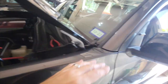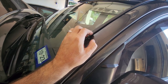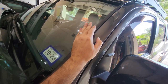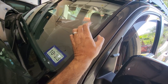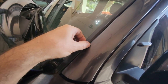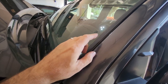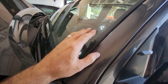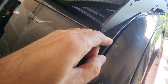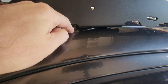All I have left to do is tuck the wire along here. I might use a piece of plastic — something that won't damage the trim — and gently tap it in with a hammer. I certainly don't want to get into the windshield over here. I did check the depth of this groove and it's much wider and deeper than the wiring, so there's plenty of room. The only hiccup will be up where it narrows a bit, and then the rest will just sit beside the roof frame — friction should hold it.